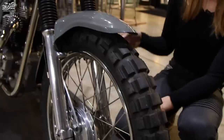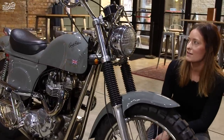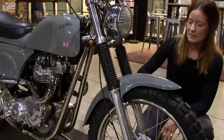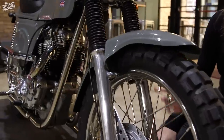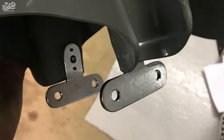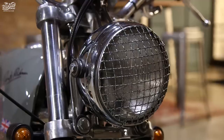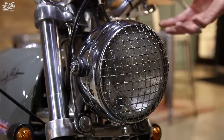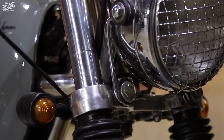The forks also came off the Triumph Adventurer from 1975. They hadn't ever been used on a bike so they were good to go. I just had to make a small adjustment so the mudguard fitted — I made a bracket in here to fit the mudguard nicely. Usually there's a tie that goes on the outside and I didn't really like the look of that. So the headlight and the bracket are meant for these forks.